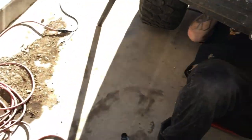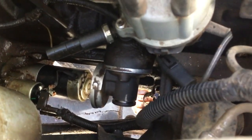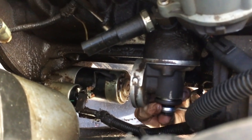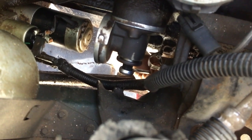Match up the O-rings, put the thing back on, tighten it back down. Don't listen to anybody about completely removing the 90-degree adapter — there's a roll pin in there, and unless you have the motor out, you're not getting that roll pin out at all. And don't put red Loctite on that.